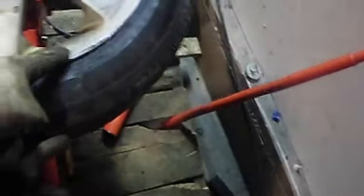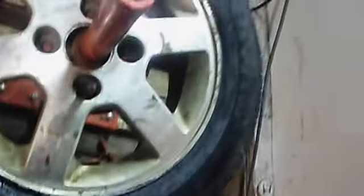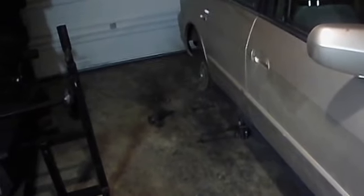The biggest trick and the biggest takeaway I think you guys can get is putting the vice grip on the handle, and then keeping the tire from popping up. Because if you don't put that vice grip on, as you're walking around, flipping the tire over the rim, this will want to walk right back off, unless you're holding down on it. But the effort of holding down and lifting with the other hand, you might as well just put the vice grip on, and then you can walk around nice and easy. You can see it wasn't that hard. The tire's on, it's holding there. All I have to do is zip it back up, and I'm good to go.